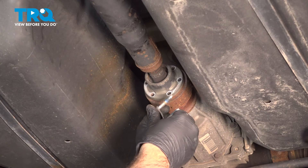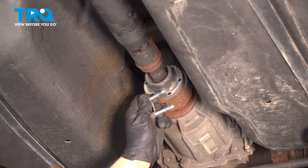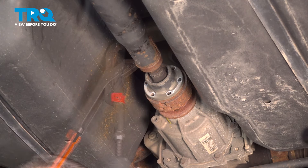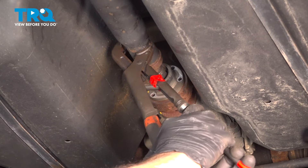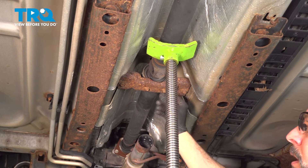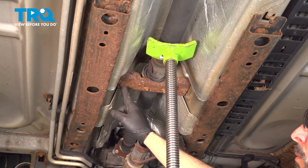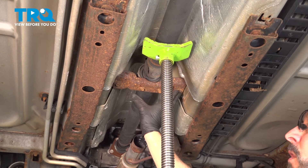As you remove these, also note that these bolts have blue Loctite on them. Upon reassembly, be sure to reapply blue Loctite. Go ahead and rotate this back so those lines line up. In the center section of our two-piece drive shaft, we have a carrier bearing. We want to remove this bracket — we're going to keep the carrier bolted to it — using a 13-millimeter socket to loosen and remove the two bolts.